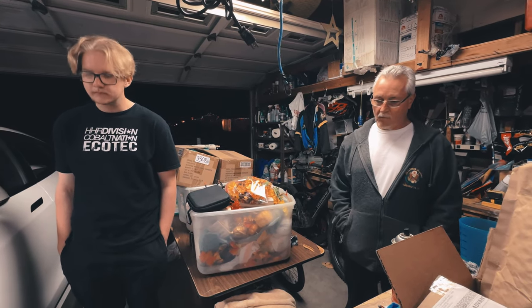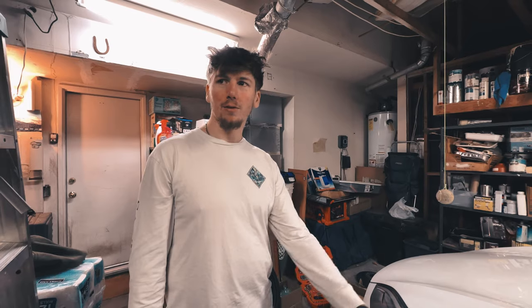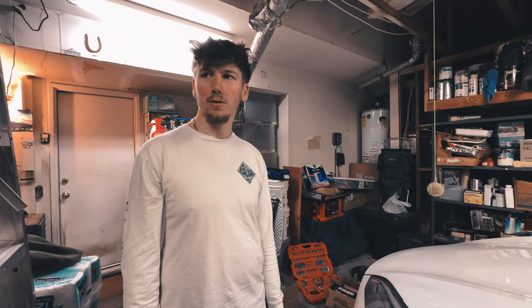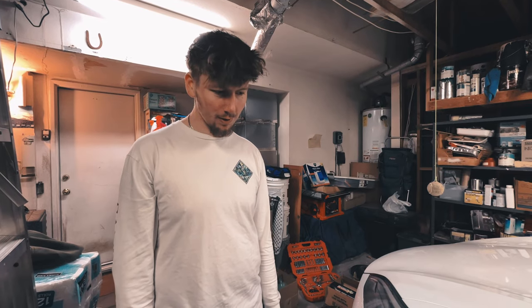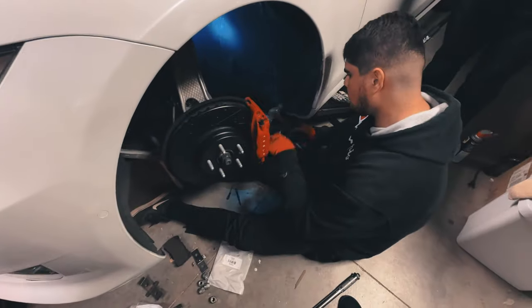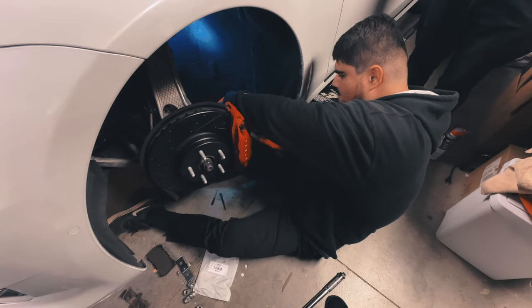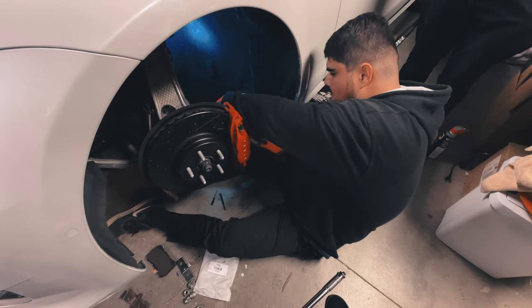Yeah, it's a performance design. So make that a key point. It's designed to be able to swap them out quickly, just on the track. Pull them out and drop them in. Wow. Okay. It's track oriented. So if you're not replacing the rotors, leave the calipers in place. Pretty much. Pull the pins, pull the pads out, put the new pads in. Call it a day.